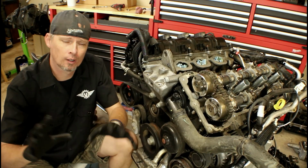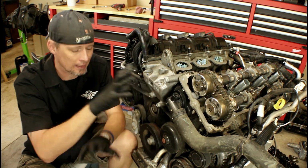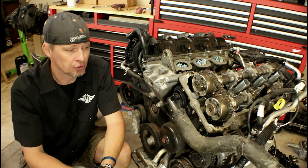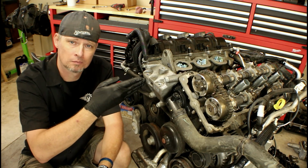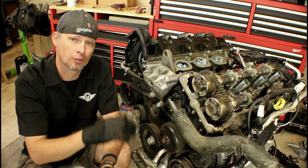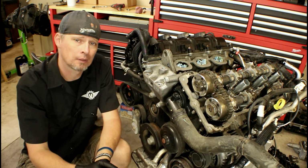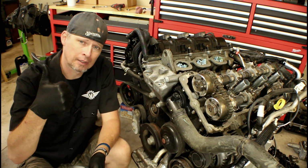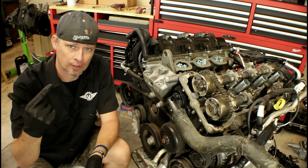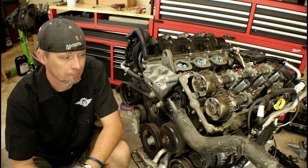Now in a perfect world, we would never have any issues with that oil filter housing. But heaven forbid something happens, right? Now you've got those two options. You can go back to the original style. Then there's no confusion whatsoever. They'll have the right oil filter every time they do the oil change. Or you can go to the late model, 2014 and above. That way you're going to be saving some money on the part. The other thing is you don't have to worry about that bypass valve or that tower coming loose. So you certainly have options and you've got something to think about.